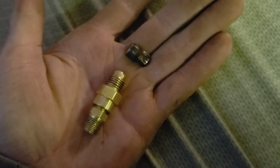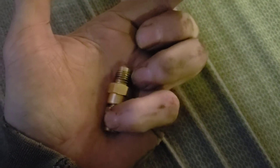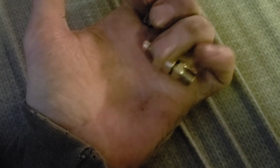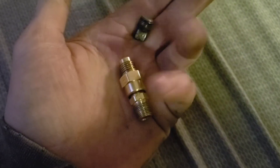Back inside — it's kind of cold out there. This is the fitting I took out of the block right here. I went to a couple different stores in town and this was all I could come up with to make the right thing work — it took me a while. I ended up having to get one at a 45-degree angle to fit behind that oil cooler. Most aftermarket gauge sets will come with adapters and you'll probably have the right one. Mine was three-eighths — I believe they're quarter inch or three-eighths — but it depends on whether you have a turbo or non-turbo truck, the 6.9 or the 7.3.